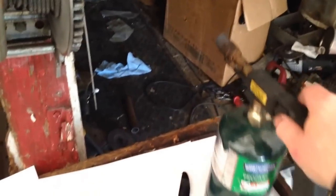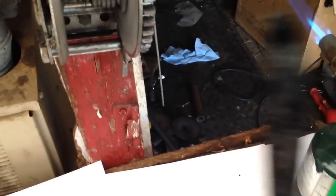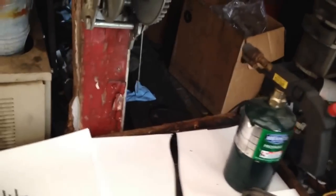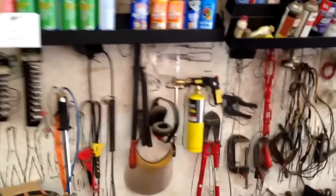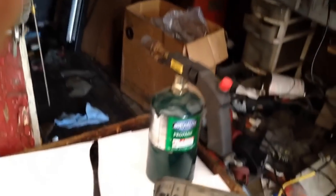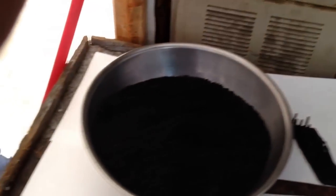I used a torch and heated up the middle of the knife so most of it would be hot — that's what I used to cut. When I put it back together I'm probably going to weld some of it; I have a plastic welder. Or if you don't have that, you can use a hot butter knife with the torch. Use the cheap green tanks — I also have a Bernzomatic with a MAPP gas can but that burns a lot hotter and is more expensive. You can get the green tanks pretty cheap at Walmart. Get it good and hot — doesn't have to be cherry, but if it's starting to turn cherry you'll be able to work with it for a few seconds and cut.